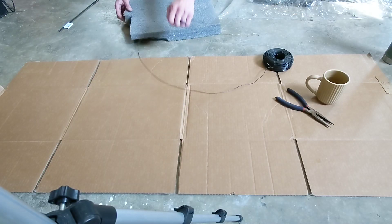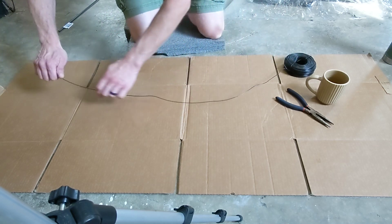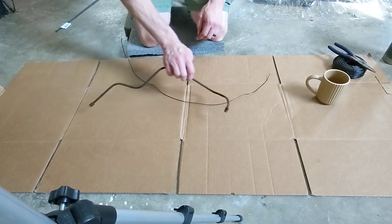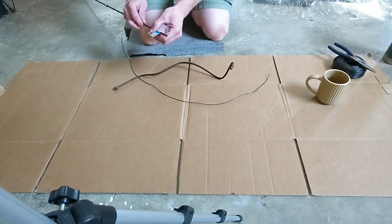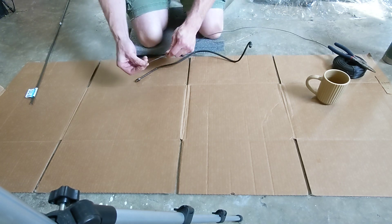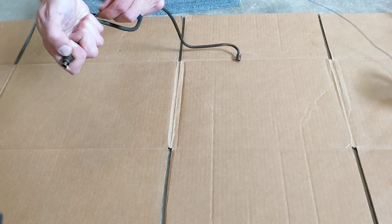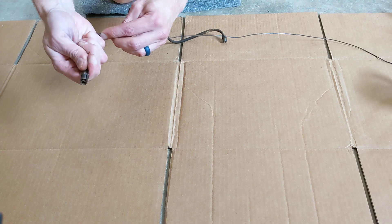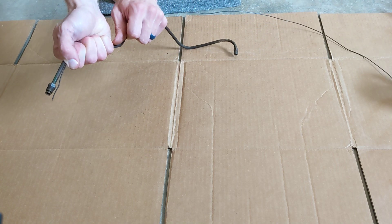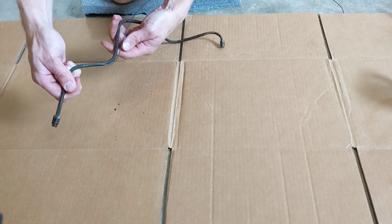Let's get this thing copied. Get yourself some steel wire — this is just cheap rebar tie wire. Anything that you can basically form and will stay put is what you want. Get yourself a few feet of this. We're going to take our old fuel line — this is quarter-inch line. Basically what we're going to do is take this piece of ductile steel wire, start here at the end of the flare, and come down, making sure that end doesn't slip. It's not a perfect science, but we're just going to keep working our way down, bending this piece of steel wire to match the profile of this old line.